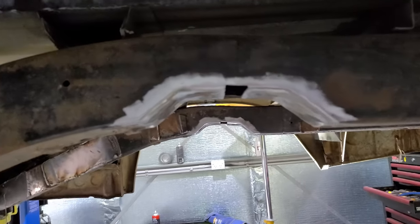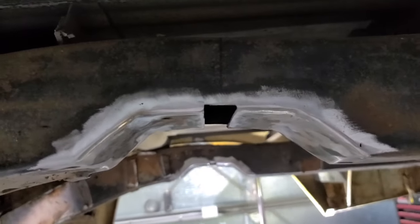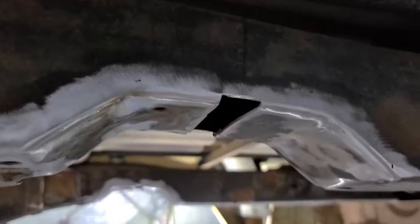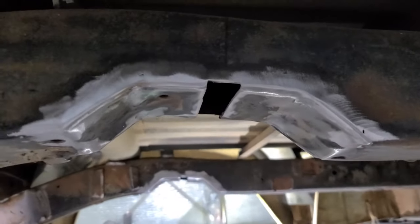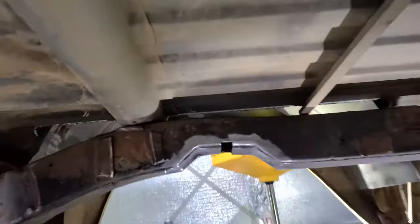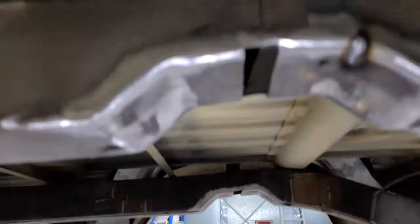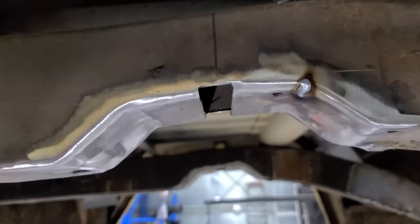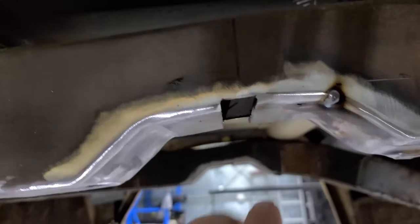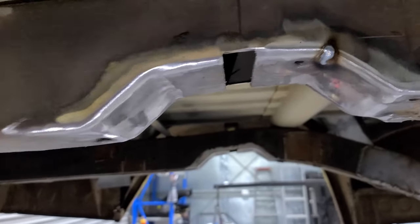I figured out when I tried welding this and just kept doing bubble shit welds and had no idea what was wrong. I turned it, reversed the polarity on it, and it's welding like normal now, so I just ground all the welds back. I've got a welded plate in the middle now, just down here on both sides, and then I can move on to the next step.